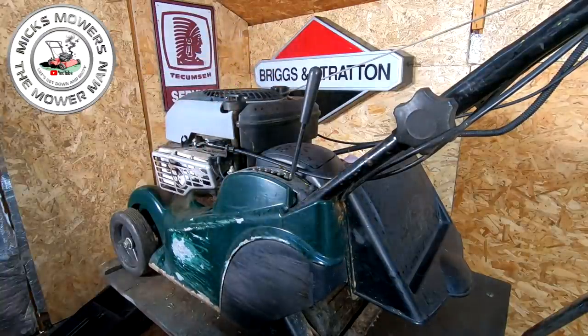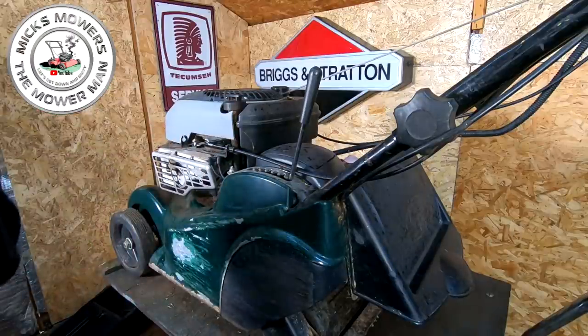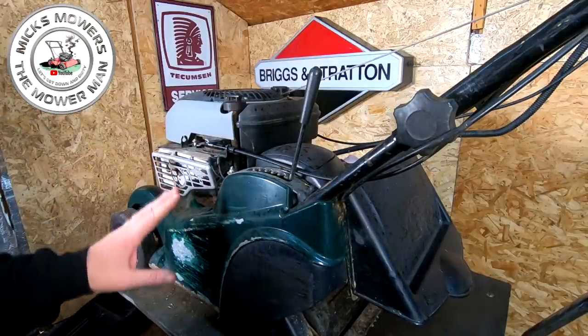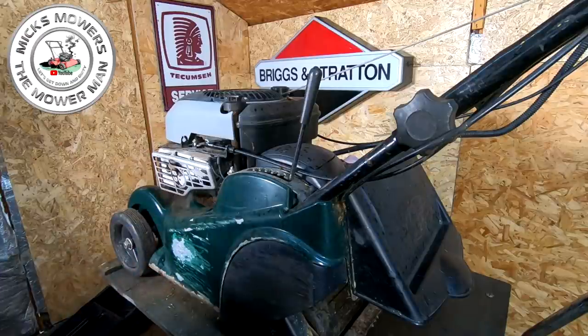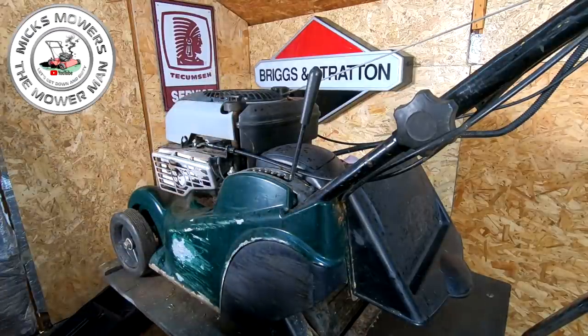Just remember to fill it all back up before you fire the machine. And by tipping the machine onto its side, you are going to get it to smoke a bit, because if you don't remove it, it will smoke. But when you're doing what I do, it doesn't matter if you have it upside down, because generally what I'm going to do is a service machine anyway, so it's irrelevant. But you should always tip a lawnmower up, carburetor side up anyway.